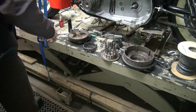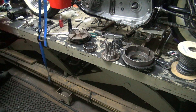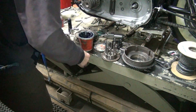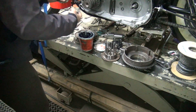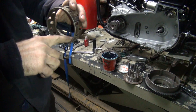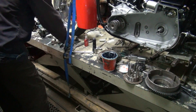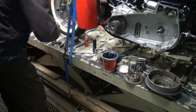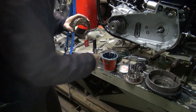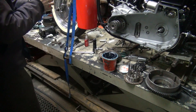Let's see — where is my grease? Right here. So basically, just put a bunch of grease in here and start stacking those loose rollers in — which are over here. So you go in there like that, put a little more grease in there to hold them, like that, and then you move on. Eventually they're all in there.